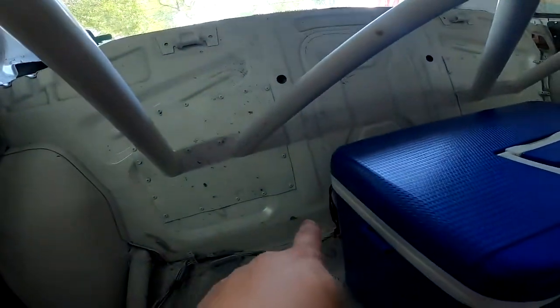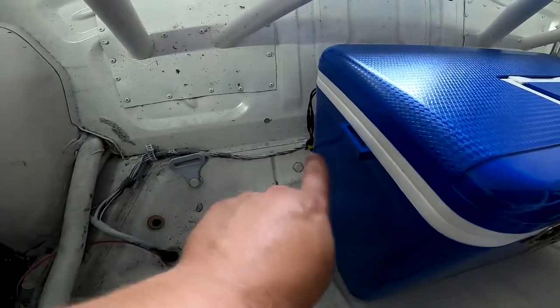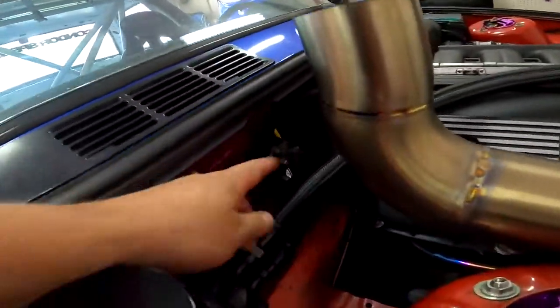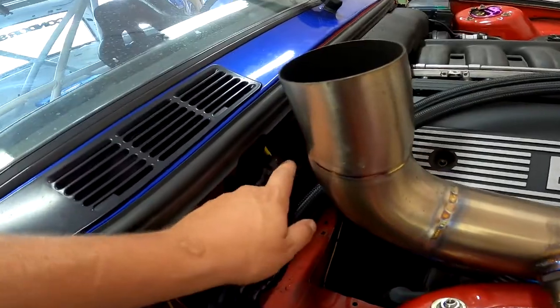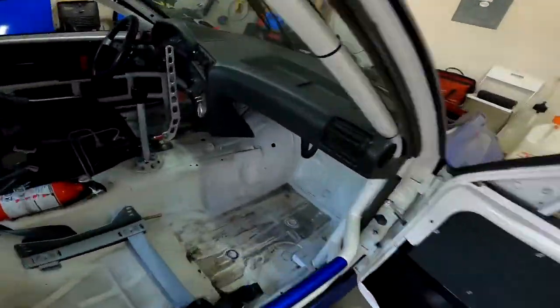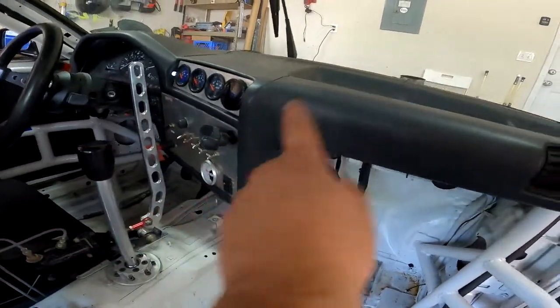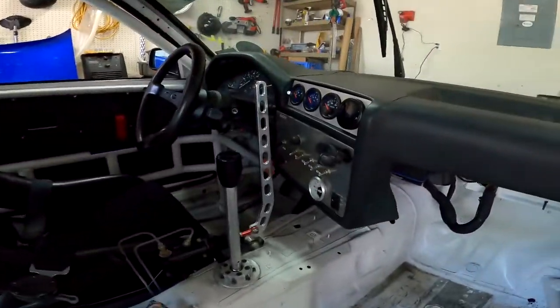So before we go ahead and start running the water lines, I want to get the electrical part of this all done. The plan for the ground — I'm either going to run a wire through this firewall right to the battery on the back side, or I'll just ground it to the chassis somewhere right here by the cooler. And for the positive, I'm going to follow this harness that I have. It goes all the way up to the front of the car, up to a power distribution block that I have right here in the engine bay. This comes straight off the positive terminal of the battery, so I'm going to hook up the positive from this connection, run it inside the car, and hook it up to a spare switch that I have here. I'm going to put a fuse in line between the switch and the distribution block, and then from the switch it's going to run down to the cooler so that way I can turn it on and off from my control panel.